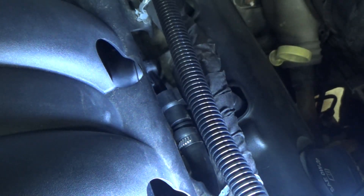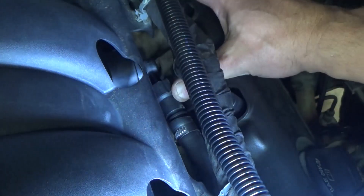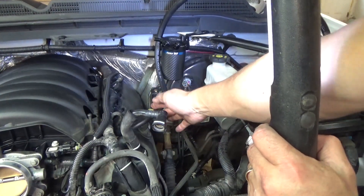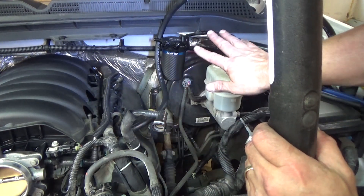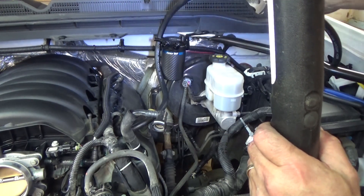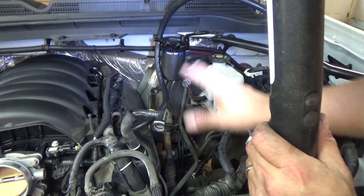Here's a good shot of the intake manifold port. Take one of the vacuum lines with a quick disconnect provided by ADD W1, run it right down beside the manifold and valve cover — just like the vacuum line we removed — and push it into place. This will run to one of the clean side ports.